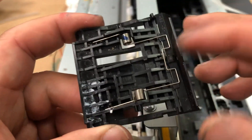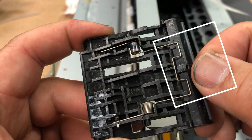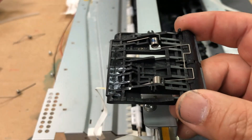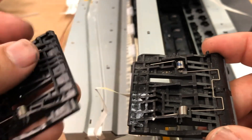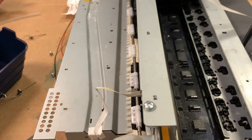It sits on top of the paper feed rod, which holds the paper, so it pushes the paper down and when the rod spins, it can feed the paper. I'm going to refer to those two tabs as shafts during the installation, so just remember where they are. There's a triangle assembly that has two wheels on it and they get pushed down by this big spring. Very likely during cleaning you may have the front side of the UPG missing, so like this one — now you'll know how to install it.